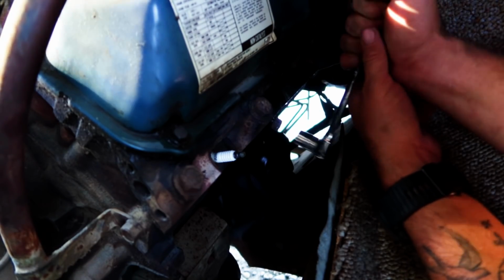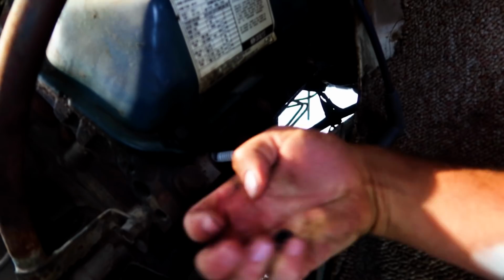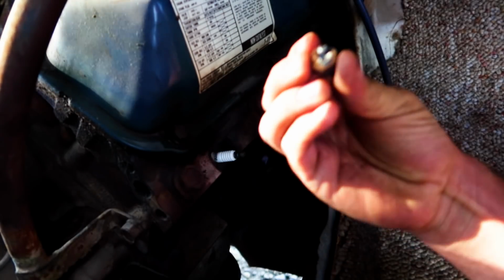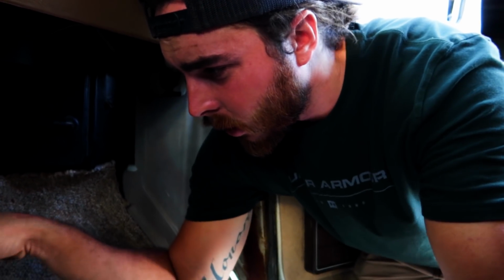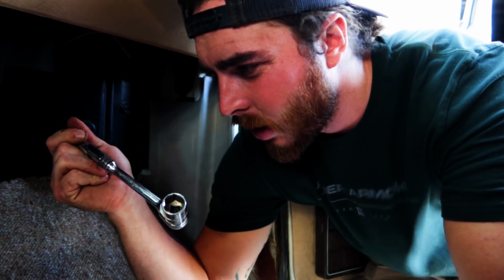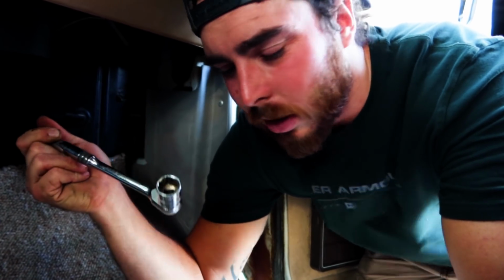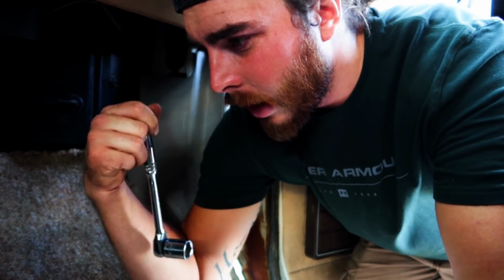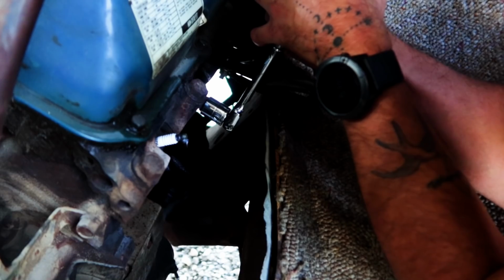I think it's spinning the weld off. Why isn't that working? The next thing I'm going to try is welding one back on and then just letting it sit overnight. I'm trying to do it while it's somewhat hot because it heats up the bolt that's stuck in the engine bay too. So you'd think that maybe it would help it turn out, but I'm going to try letting that weld cool overnight if this one doesn't work.